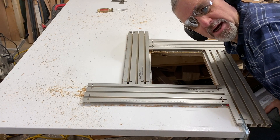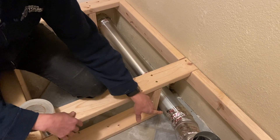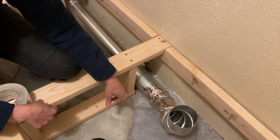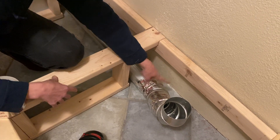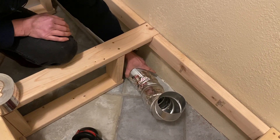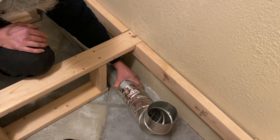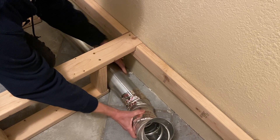We think we should have used a jigsaw. We're using hard metal ducting instead of the flexible stuff because it's a little bit better. In order to achieve the double angles going into the dryer, we're using two adjustable 90-degree elbows to bring it over and then up into the dryer. This part is from the dryer kit and I can slide that in or out to get the correct distance to the dryer itself.